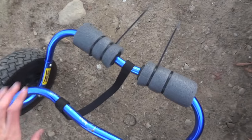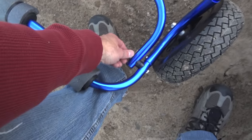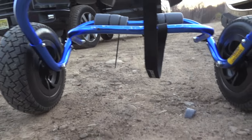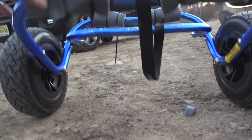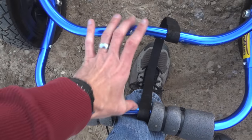The one thing I really don't like — it's kind of a glaring oversight — is that there's nothing that keeps this kickstand up aside from a little bit of tension, and this is my first time using it and it already lost that tension. So as you're going along, this thing is shaking to the point that the kickstand drops down, and then any rock you hit gets caught on it. You can see all that scarring right there. It would be nice if they fixed that. When you pull it up you have about 10 inches of ground clearance — it'd just be nice if something kept it in place. All I'm going to do is get a bungee cord from here to here to keep it pulled up.